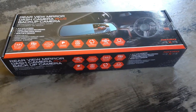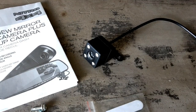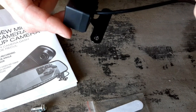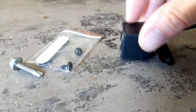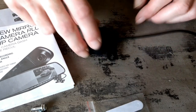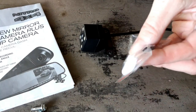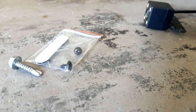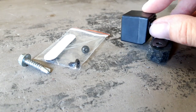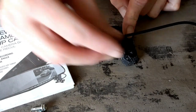This system was $45 at Princess Auto. The camera mount is frustrating — it doesn't work for the way I want to mount the camera. It doesn't come with the one shown on the box or in the manual; it actually comes with just a very simple little L bracket that you can bend to adjust, which mounts fine on the top side but for the bottom side it doesn't sit flush, so this gap means I can't screw it right-side up onto the top of my van. The screws it comes with are silly anyway, so I was going to cut up a hockey puck but I ended up finding a little chunk of rubber. I trimmed it down to shape to use underneath so it will actually sit on the van with some clearance, and then I can bend it slightly to adjust from there — and I'll end up using some way bigger screws also.